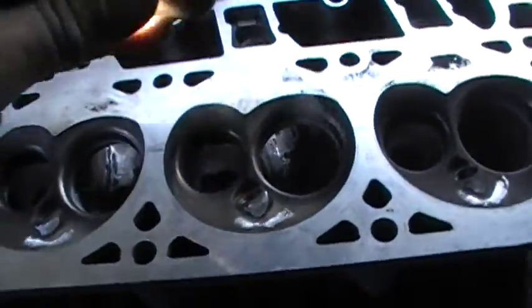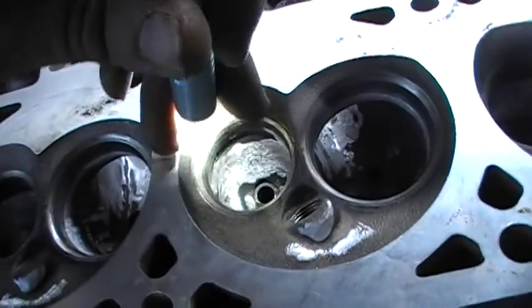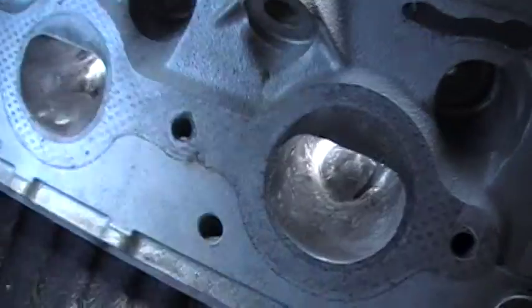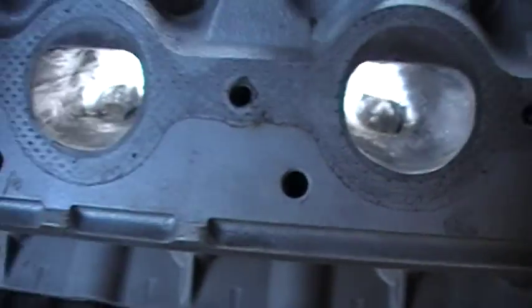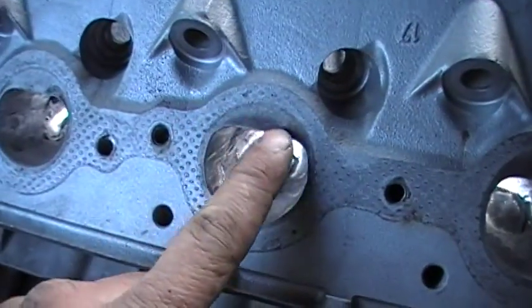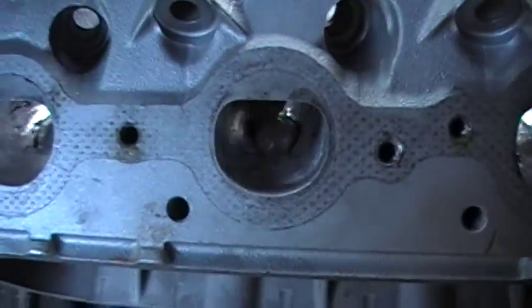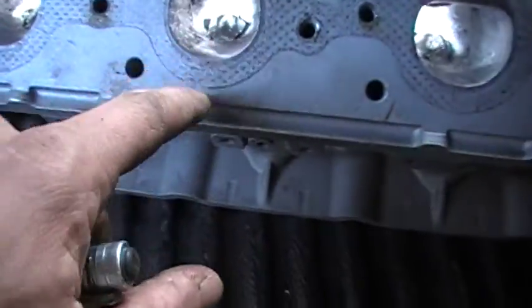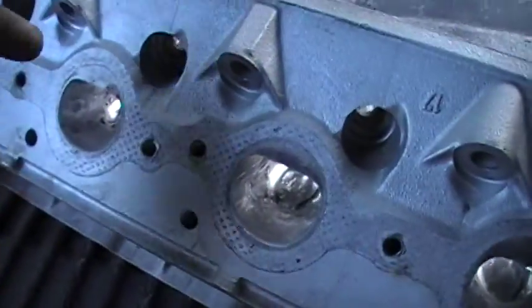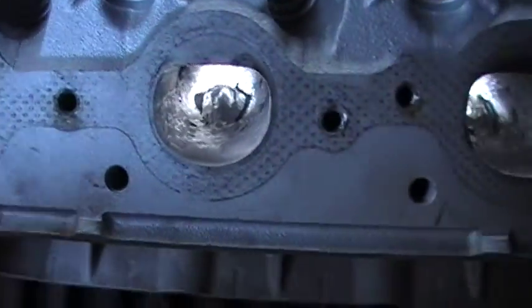The exhaust had kind of a rough edge back in there, so I cut that out. I opened the exhaust up at the top because, working with big block fords, I know if you cut the bottom out of a big block ford it doesn't help anything — all the air is coming out the top and trying to come out the top here, so it really doesn't matter at the bottom. You've got to think on exhaust and intake differently — which way is the air flowing.